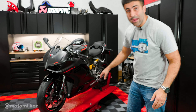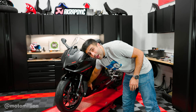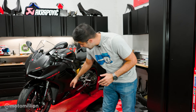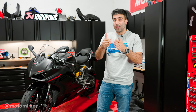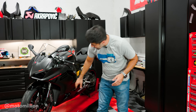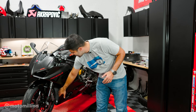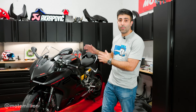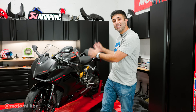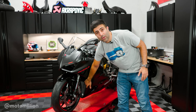The bike is looking so good already — because it has a lot of red accents, these caliper spacers work really well, and there are going to be a lot more red accents coming for this bike. Just the fact that we have the radiator guards on means it won't get stone chips. Why don't I ride without radiator guards? Because the thermal efficiency of your radiator depends on all the fins on there. Once rocks get thrown at it and fins start bending shut, air can't go through it, lowering thermal efficiency. By putting a screen in front, we might reduce a little airflow, but by the time you put 500 miles on this bike without guards, there'd be so many bent fins that the screen's reduction is minimal. And I'll throw a Ducati joke in — we know how hot these things run, so you've got to try to keep it as cool as possible. With the guards on, this whole area is blacked out, so it looks much better too.